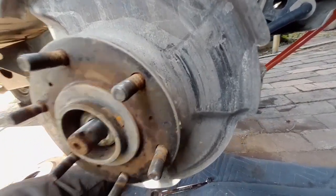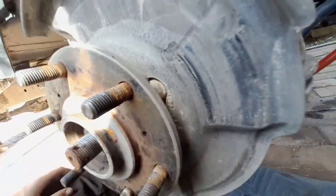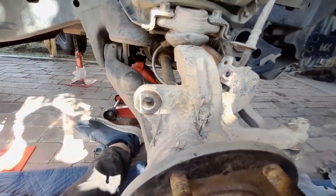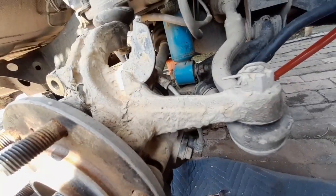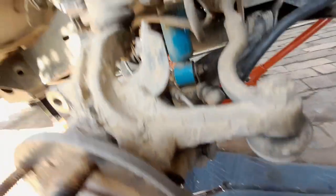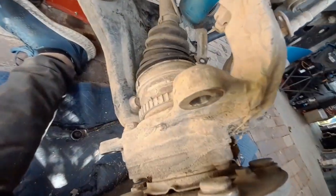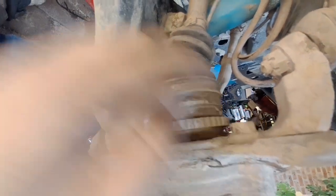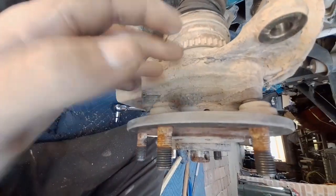The caliper and brake rotor are off now. There's a bolt right there for the rotor — just the one — so take that off. At the back there's a metal shield sitting on top of the ABS sensor teeth, held by a 12mm bolt, so remove that too. Then there are four hub bolts — one here, one there, and two on the other side — they come through on both sides.